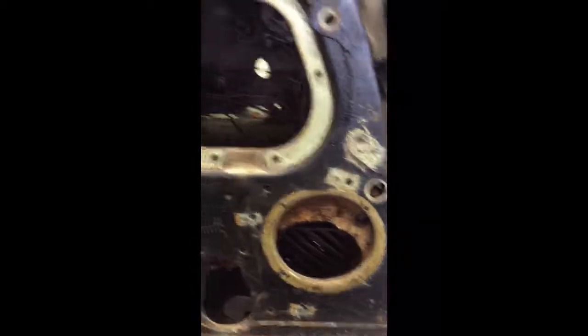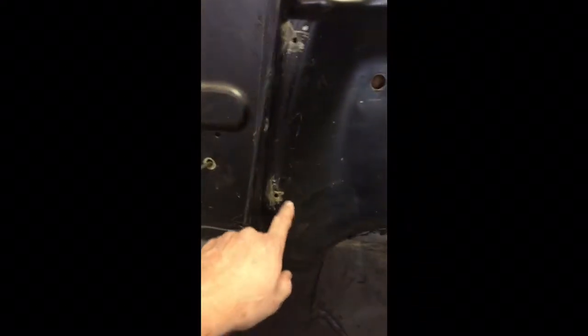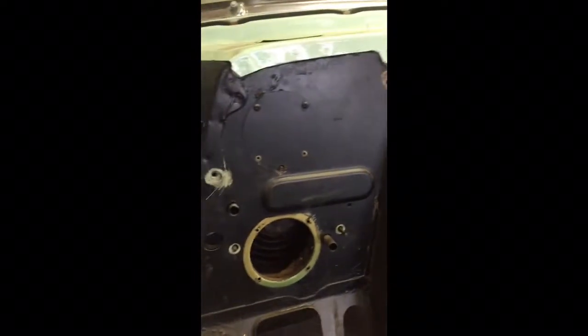I'm going to go ahead and smooth this firewall. Probably not do too much with this transmission tunnel as of yet. I'll have to see once I get the body on the chassis how well that fits. I am probably going to have to do a little clearancing here for the passenger side head on the LS1 motor that's on the chassis that's going under this thing. I built that with Mustang 2 front end and a 4-link suspension.